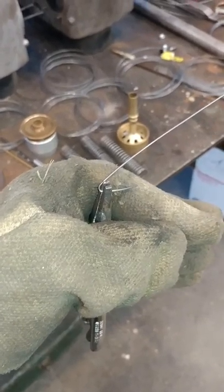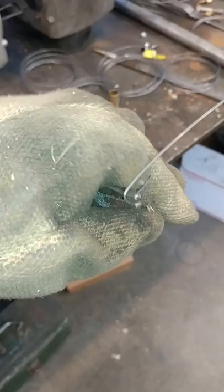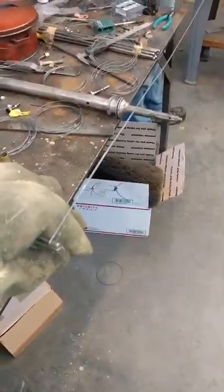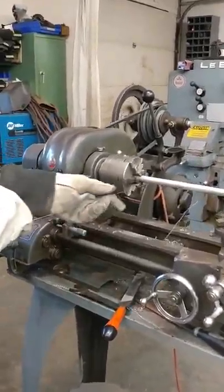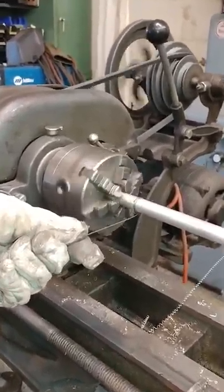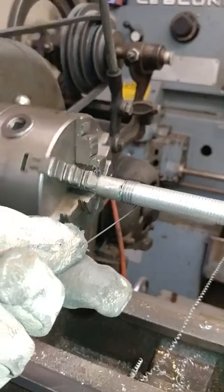In order to control the wire, it is clamped in a set of vice grips, and I'm using a gloved hand as well because if it snaps it can cause a nasty cut. The wire is under tension and now the lathe on a slow back-gear setting is used to wind the wire in and set the coils.